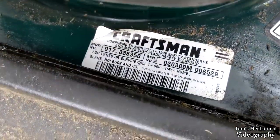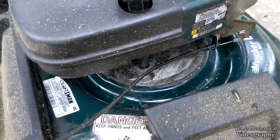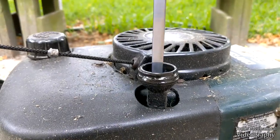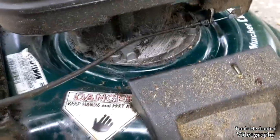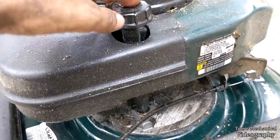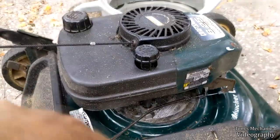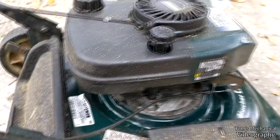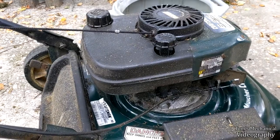Model number 917388350, and here is where the issue lies. This o-ring is not doing its thing. Cap is not stuck — that would have been my first thought, that the neighbor forced it and broke something off — but I think this is supposed to be held in by pressure. There's a little arm right here doing a lot of movement, so I'm wondering if the o-ring is cut. I'm going to take the cover off the top — probably three screws — and see if there's a bolt that's walked off or if the mount on the side of the filler neck snapped off, which may just allow us to put oil in it.